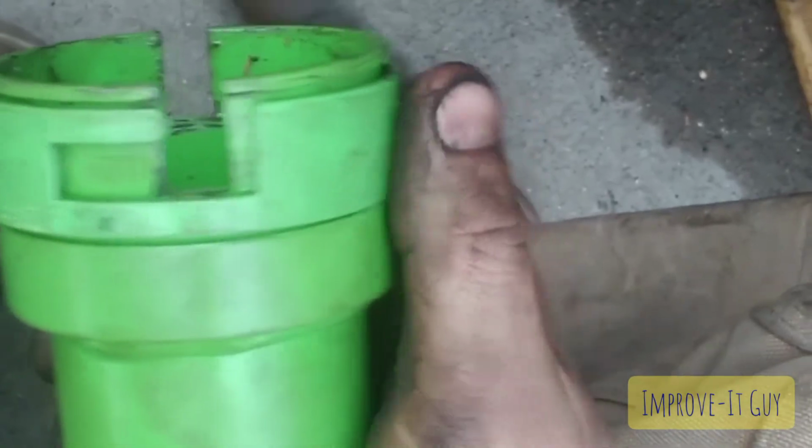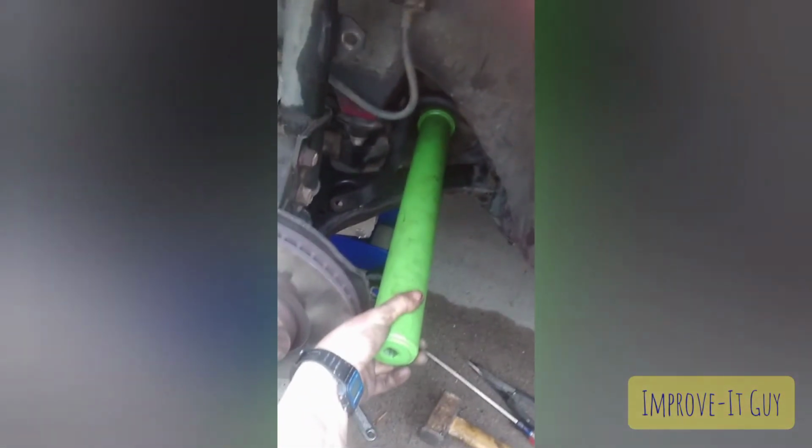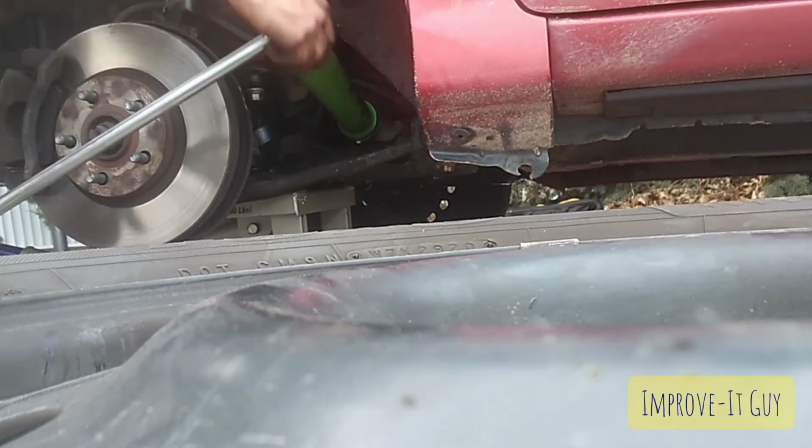Okay, because our tube section of the tool has these two openings with a locking mechanism on it to lock those wings in, so you can turn it with your breaker bar. Okay, so I had to get my second hand back here to grab onto both of those little wings and push them into the little slot there, and then I can use my same hand to close this little latch for the closing mechanism. Now we've got this on there. It's just one big wrench basically, and I'm going to put my breaker bar on there and we'll turn it off. There we go. That was it.